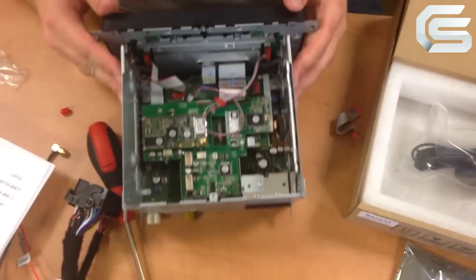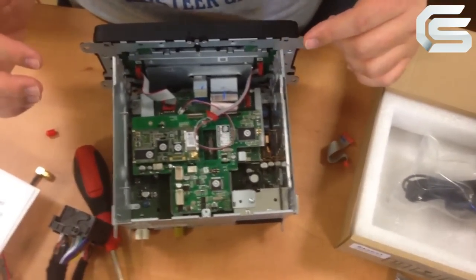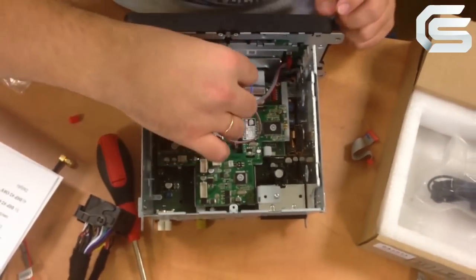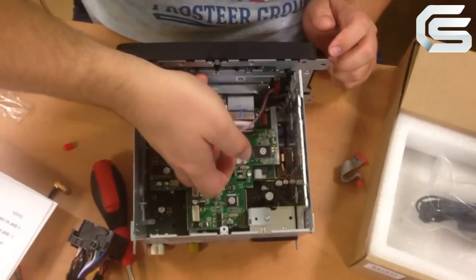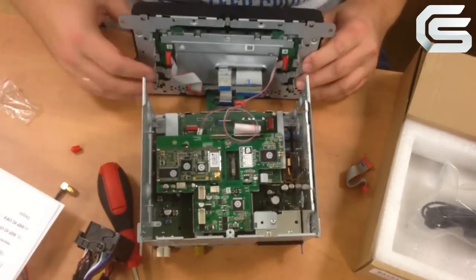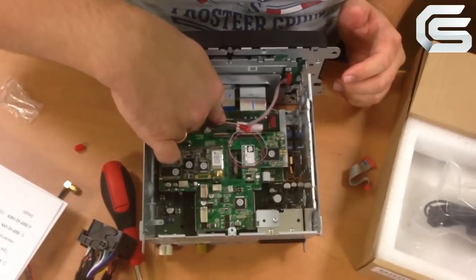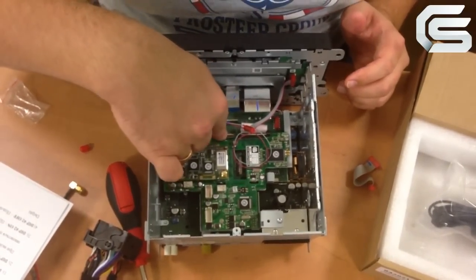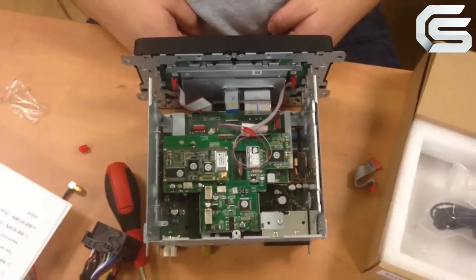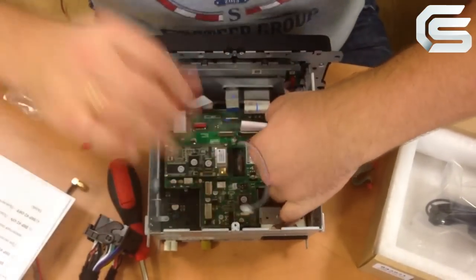Now let's connect all cables. As I've said, we can use the embedded SD card reader or an external one. This narrow shiny FFC is in charge of that. It goes from the card reader of the monitor. In our case, we can connect it either back to the OEM socket or to the socket on the video interface. If you connect it to the video interface socket, you will use the card reader on the monitor for the purposes of the navigation mainboard. Let's connect everything.